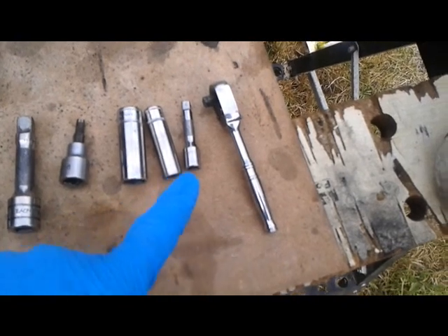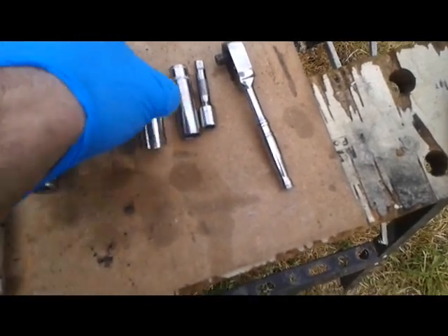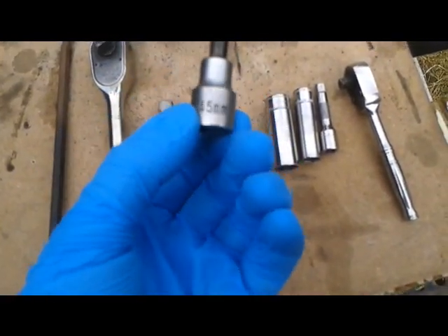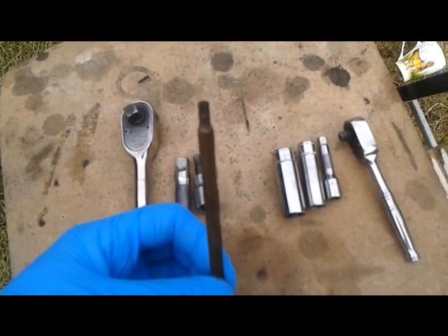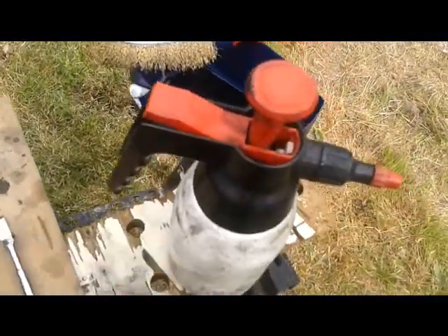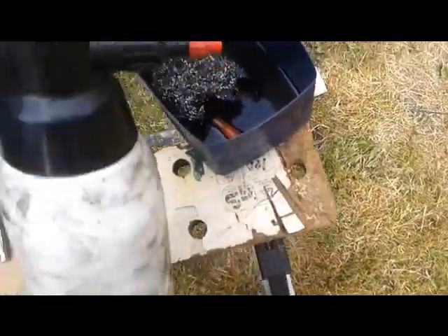The tools you need to remove the EGR valve are the 10mm hex drive and the 13mm — these are a quarter drive. To remove the throttle housing you need a 5mm Allen key; an extension is handy, 3/8 drive. And to remove the solenoid from the valve, use this long reach T25. These are all the tools you need, plus some parts cleaner, some wire wool, and a wire brush which didn't actually come in handy.